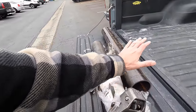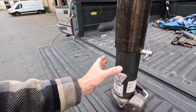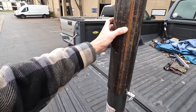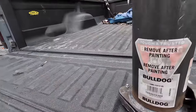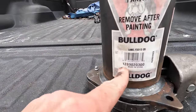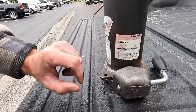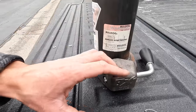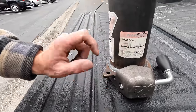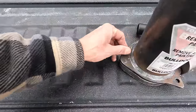I've got it unwrapped now. The inner tube slides inside the bigger outer tube, which gets welded to the trailer. We need to drill one hole all the way through so a pin can lock both pieces together. One cool detail: the manufacturer puts protective covers over the labels and instructions so you can paint the coupler — or in our case powder coat it — then peel the covers off for fresh stickers. There's also a zerk fitting on there, which I've never messed with on a gooseneck coupler before.